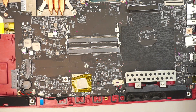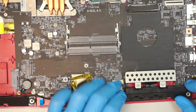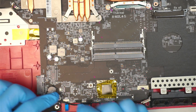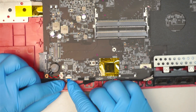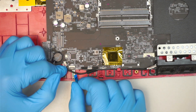Coming back here to take a look at the speaker — that is the connector for the speaker, slide it down. And that is the CMOS battery for the motherboard; you have to remove it by sliding it to your right to disconnect it. Here comes another little clipper — flip it open, the tiny clipper here, flip it open, and slide the flex cable down. I believe this flex cable is for your touchpad.